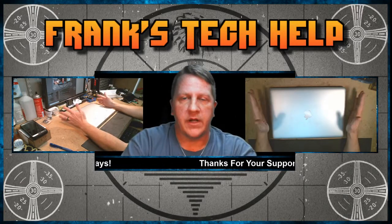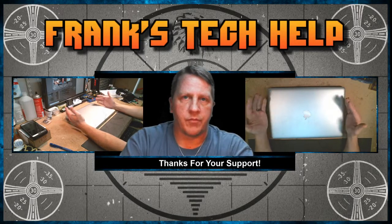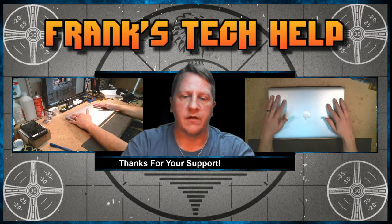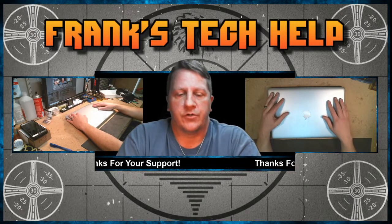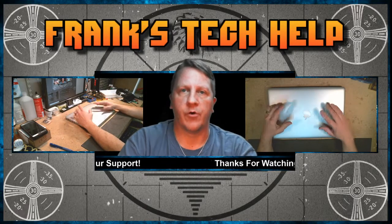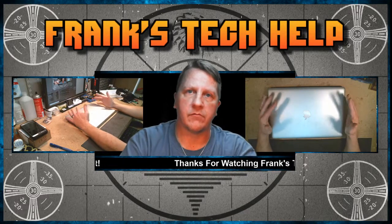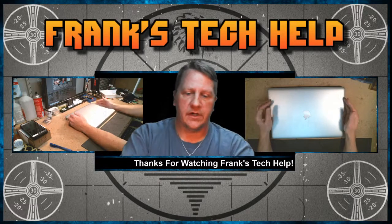So the next thing on the plate for me is that it's more than likely the thermal paste needs to be replaced. It just comes to a certain point on Macs and a lot of other laptops where you need to take it apart and redo the thermal paste to help it keep running cool. After some testing, it does shut down after a few minutes or so. And so that's what I'm going to be doing today, the thermal paste.